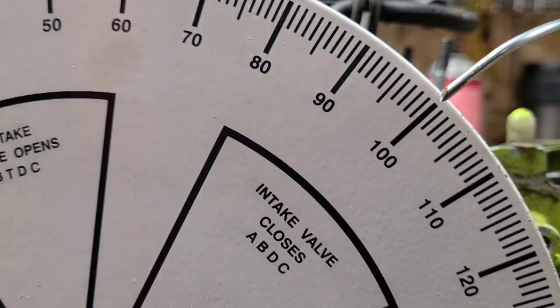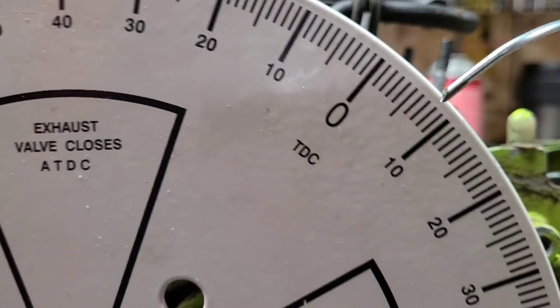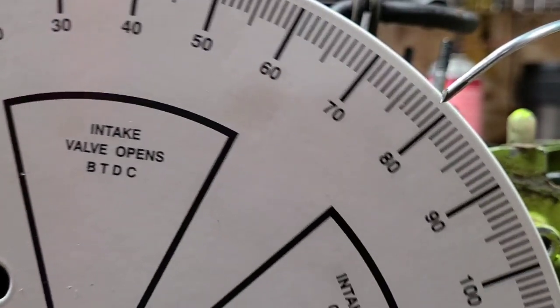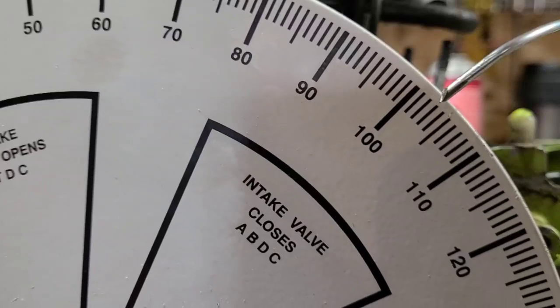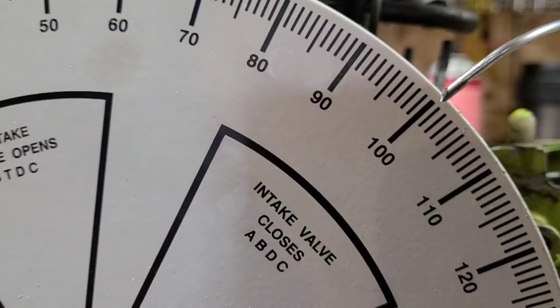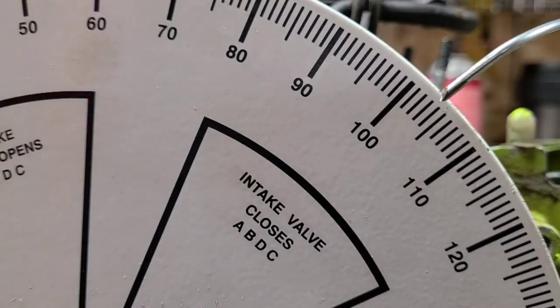Now there are ways to build torque, and we're going to go into that in future videos. Okay, so I'm just going to spin it around one more time. Bottom dead center. Spark plug fires. Top dead center. It's on its way down. It's going, going, going. Now I'm going to look through the exhaust port, and I'm going to tell you when it opens. Right there. Okay? I can see my first ray of light cracking. Okay? Right there. So it looks like it's at about 103.5, 104.